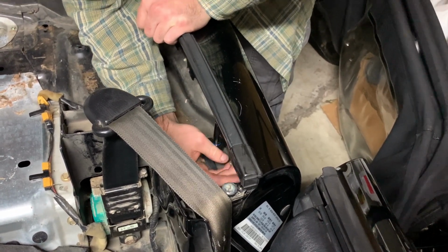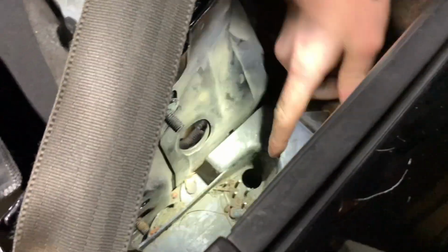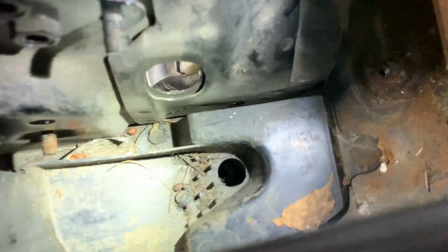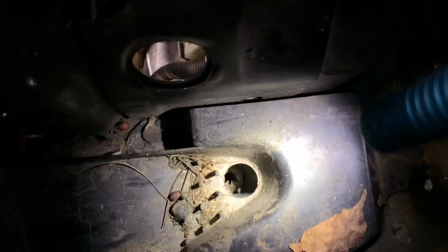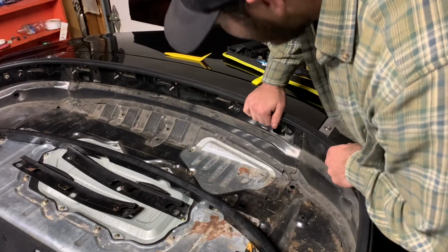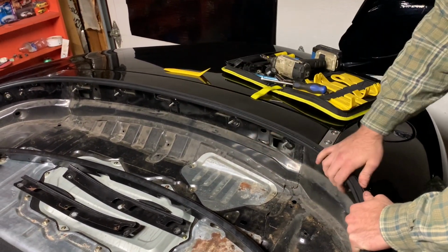Also, another important fact to know is down here. These are for the water to go down. These are your rain rails, and they're very important to clean out because if you don't clean those out... Ooh, hold on. They're dirty, aren't they? Yeah, you can see. Well, that's a leaf. Yeah. The previous owner cleaned them out before. But your rockers will rust out. But it is as simple as pulling those off.